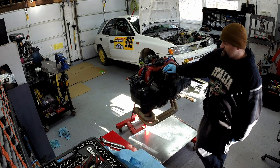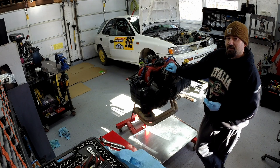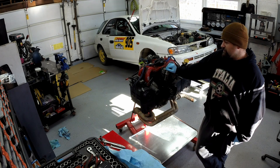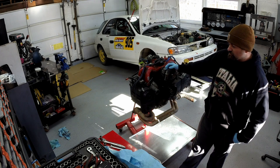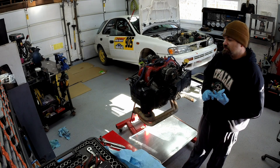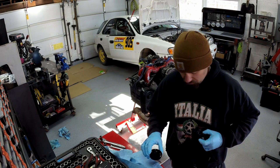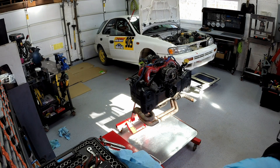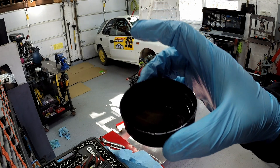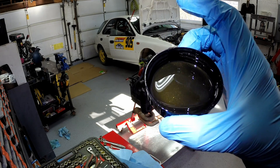We're going to tear this motor down and see exactly what happened. I'm not too familiar with these motors - this is an EJ25D, it was swapped into the car at some point, so I don't know much about its history. The symptoms were: engine didn't want to turn over, resistance when turning over, crazy high oil temperature, then knocking and metal shavings in the oil. I even pulled a little sample out of the oil filter so you can see what I'm talking about. It's mostly fine stuff with a couple slightly larger chunks.